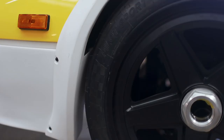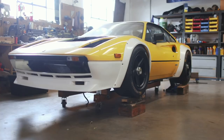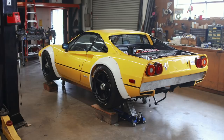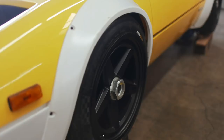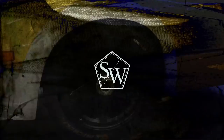After taking a bunch of measurements off camera, the good news is that the overall diameter of the 18-inch tires will run is only about a quarter of an inch bigger than the 17-inch setup, so the difference is pretty negligible. I don't have to worry about how these will clear the bodywork or worry about blowing up a fender. On the other hand, I do have a couple of concerns about the overall ride height of the car — the road surface of the tire is quite a bit below the bottom of the car itself, but we do have to add aero underneath, and there's a diffuser out back that'll take up quite a bit of that space. For now most of this is guesswork, but the experiment does look pretty cool.